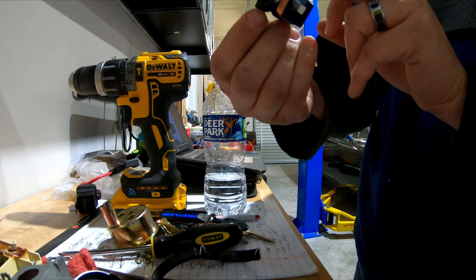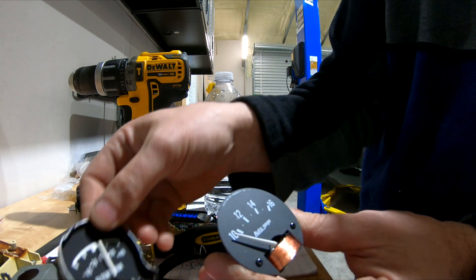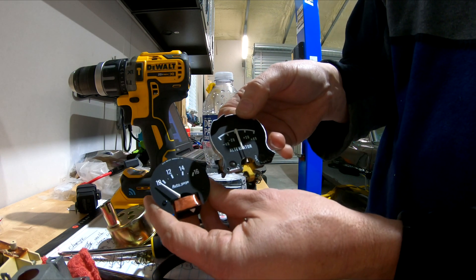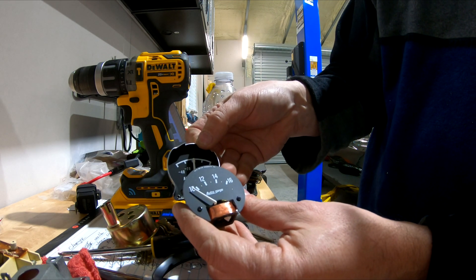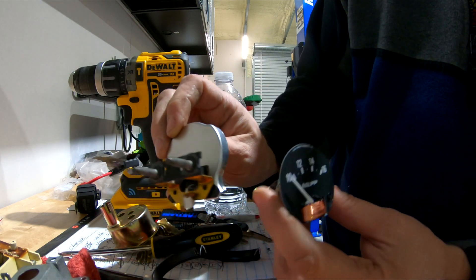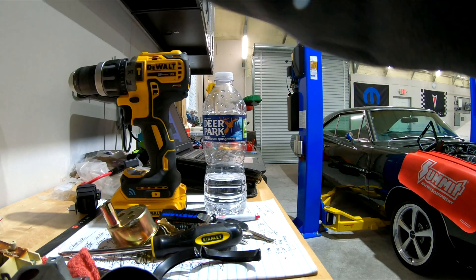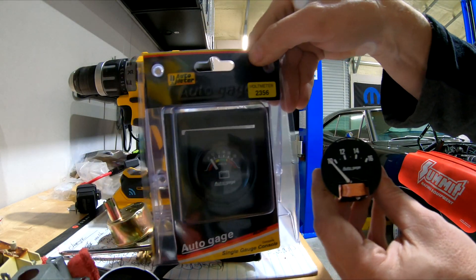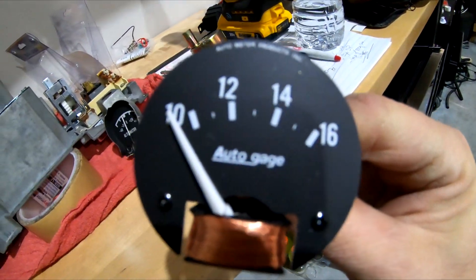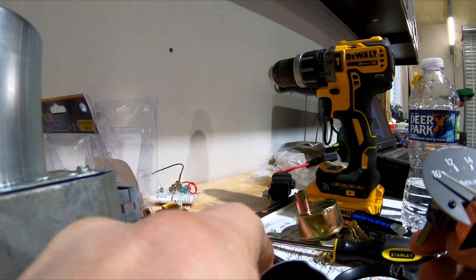The whole point of doing that was because I wanted to have this in place of this — see, that's the factory ammeter and this is the volt gauge. I'm going to convert this into the factory charger setup, hooking it all up for 12 volt instead of an ammeter amp reading. Part number 2362 will do it. I bought another gauge, part number 2356, but it was a little too small — it wasn't going to look as good. The 2362 was pretty close, so stay tuned.